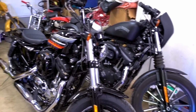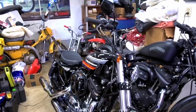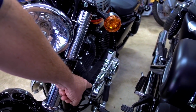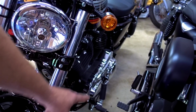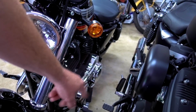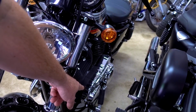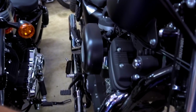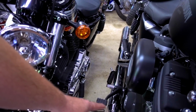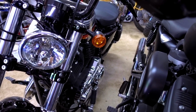I've had several people ask about gearing on the thing. So let me explain this real quick. The front sprocket, most people on Harleys refer to it as a compensator, the front sprocket for the chain case that takes the engine power and puts it to the clutch, which puts it to the transmission, which eventually puts it to the back wheel. The 1200 has a 38 tooth front sprocket. The 883 has a 34-tooth front sprocket. All you need is a $65 883 sprocket and a gasket and a quart of chain case slash transmission oil, and you swap the thing over.